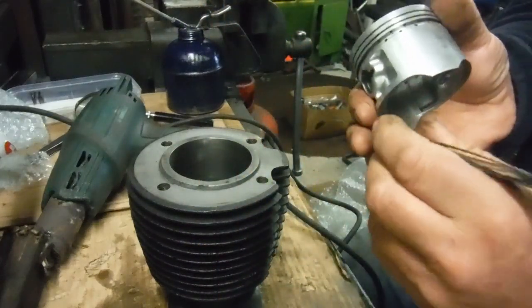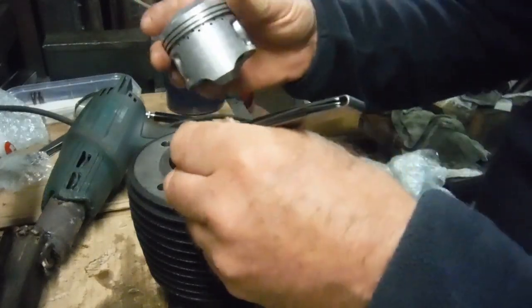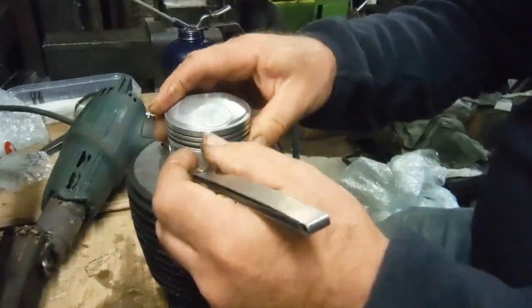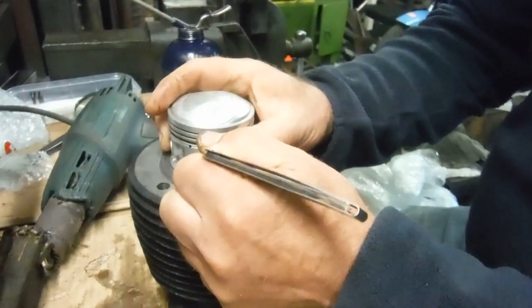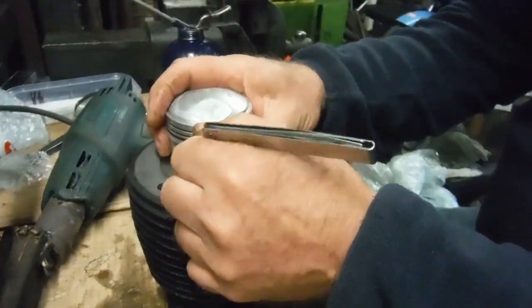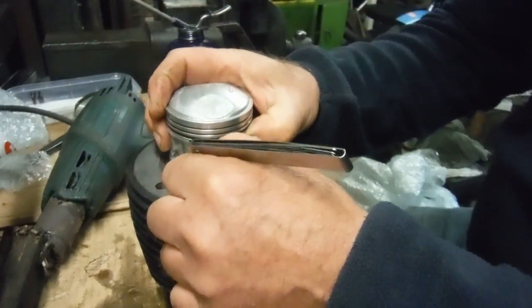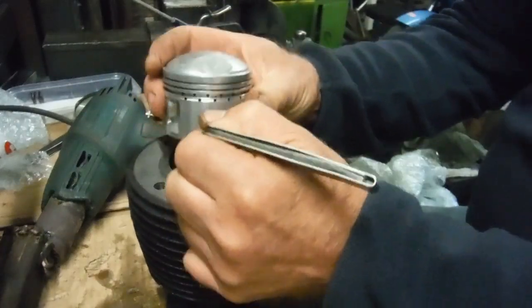What we've got here is a cold, tight four thousandths of an inch piston-to-bore clearance. It is quite a tight four, but I could push the piston and the feeler gauge blade right down if I chose to, so that's a cold clearance of four thousandths of an inch maximum.